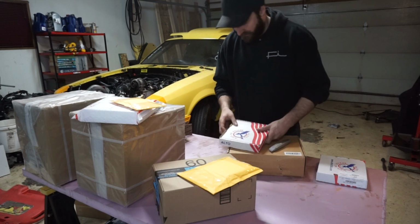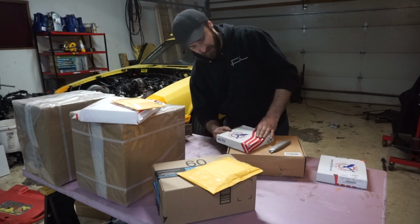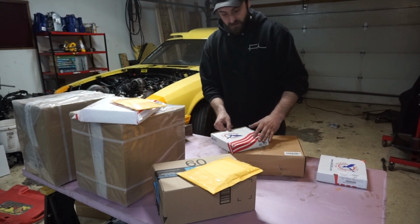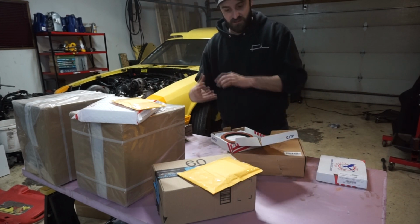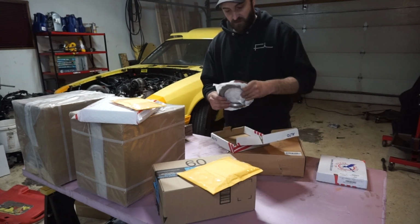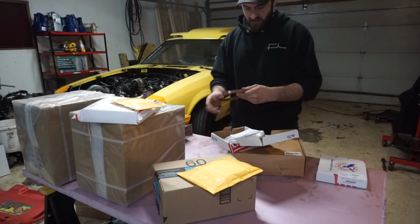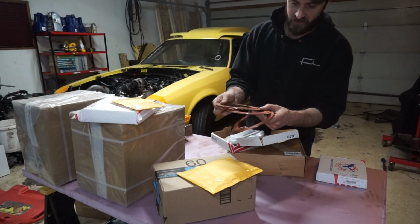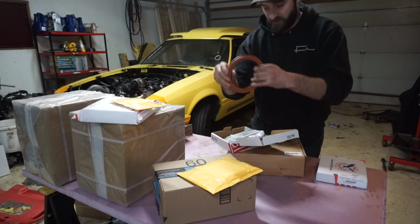Maybe I should open this up. So these are the power pack clutches, the Red Alto power packs. So basically what this does is it adds an extra clutch in each drum. So normally they would have 5, these have 6. So it comes with the clutches and the steels. 1, 2, 3, 4, 5, 6, 7. Okay, so it's 7 in the direct drum.